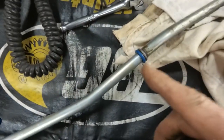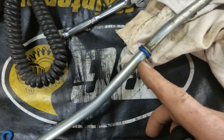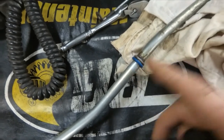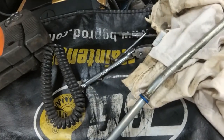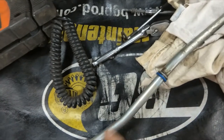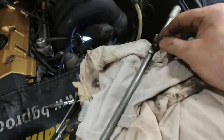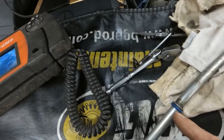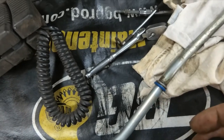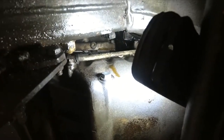I noticed when I reinstalled it that the O-ring barely went into the engine block, and yet there's about a quarter to half an inch of bore left. Remember, I changed this block from another — it was a 3.2 out of a car — so maybe the block dimension is different for this dipstick tube. I can't move the bracket down any further to push the tube further in, so I'm going to double up and put a second O-ring on it because there's more than enough room. After cleaning it off, it's still running down from there.